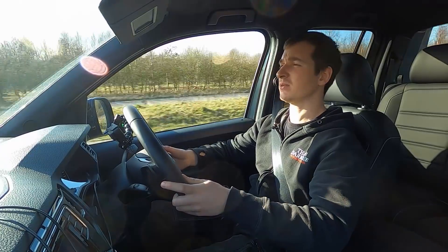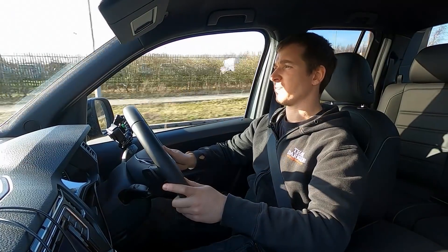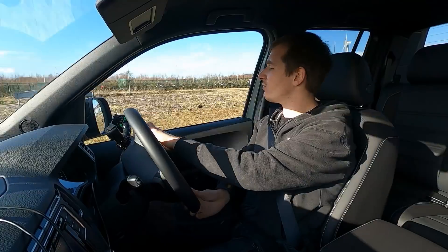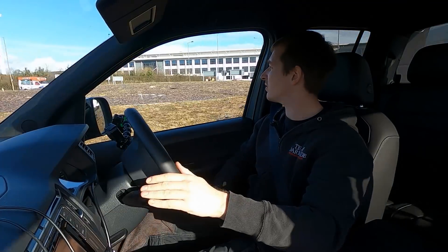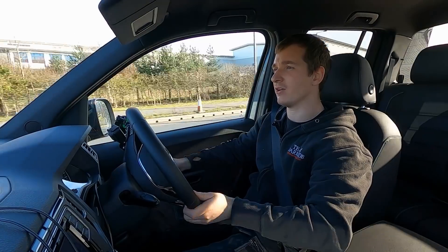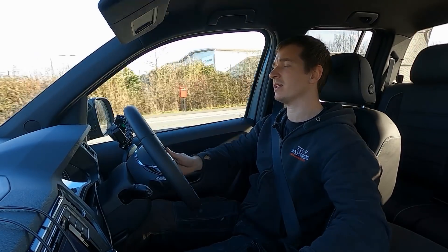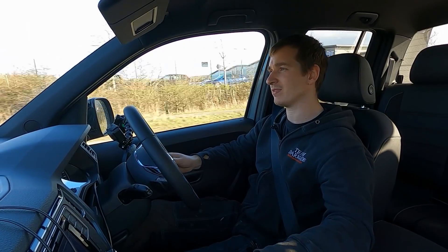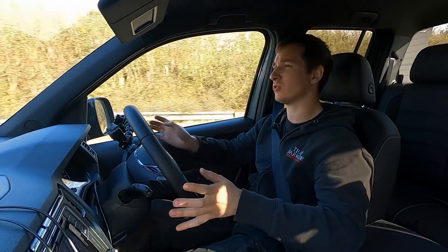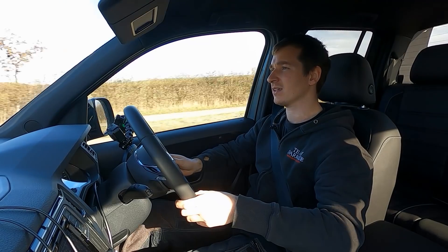In manual I'm not sure if we managed to get rid of the auto upshift. It still changes gear at about 4,800 RPM, which is something we're working on. Speaking to Mike the tuner, he hadn't got round to testing it yet, but the auto upshift isn't like the old DSGs where you can just turn it off by putting it to an RPM or speed it can never reach - it's hidden somewhere, probably in EEPROM. Anyway, we'll just need to see if it's any faster.